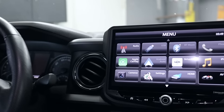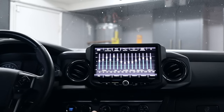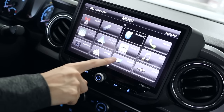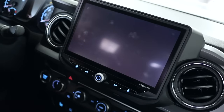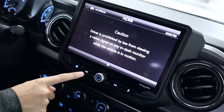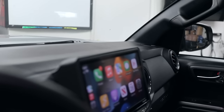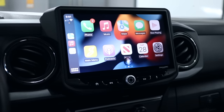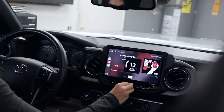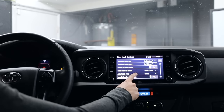I think the apps on the Stinger are more useful than the random ones on my 2019 radio. I already showed the camera app, but another favorite is sound settings — there's a 15-band adjustable EQ along with time alignment. There's also an HDMI app with an HDMI port on the back of the head unit, though while driving it doesn't let you view it. There's also an AV input on the back. Overall with the Stinger, you get CarPlay plus cool apps like the camera and HDMI, versus the random Yelp and stock apps on the factory unit. However, going from the Entune 3 2020 and up head unit, you do lose some basic vehicle control features.